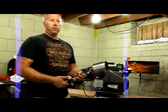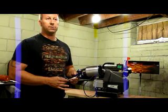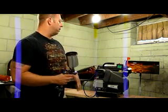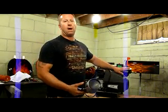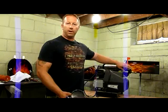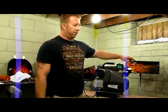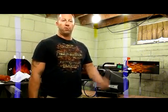I like to use a regulator on every gun that I have. My 60 gallon that I use, I don't even have a regulator on it at all, so the tank pressure is what I get at the gun itself. If your manual says 43 PSI is your optimal or maximum pressure and you have a regulator on your compressor versus your air gun, you're going to set this regulator at 43, but with the length of hose and diameter of hose you have, that can and will cause pressure drop.